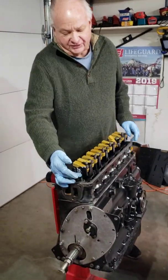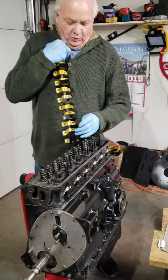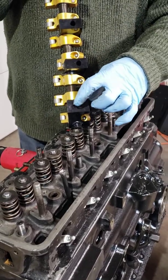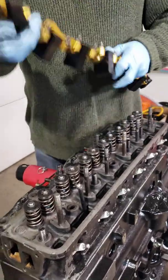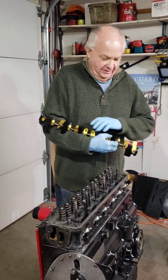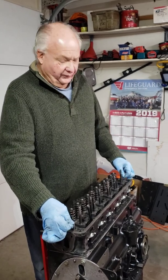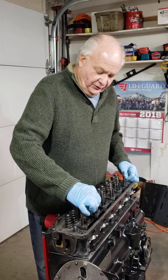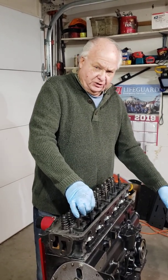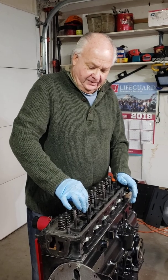If you don't deal with these studs front and rear — at the back end is where the oil hole is — it comes up from the engine to the cylinder head, up here this oil galley goes up to the main shaft. If this isn't seated all the way down, the oil isn't going to flow and you'll end up damaging the main shaft to your rocker arm assembly. That's why this head goes on and off a couple of times before it stays on. There's a clearance issue with the front and the rear stud for the head, and also for the pushrods up against the side of the opening and the casting. Your stock pushrods don't have a problem, your racing pushrods do, and that needs to be addressed or you'll have a failure with your lifters and the pushrods.